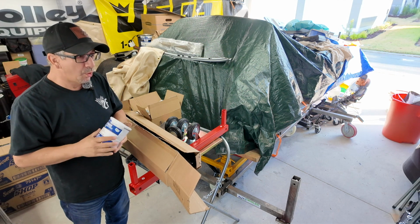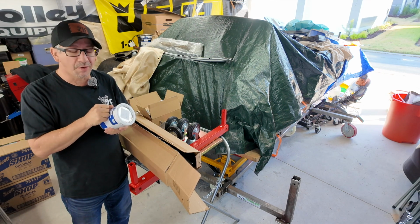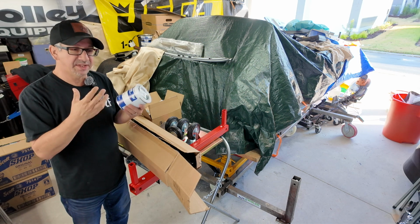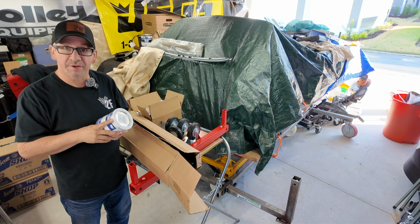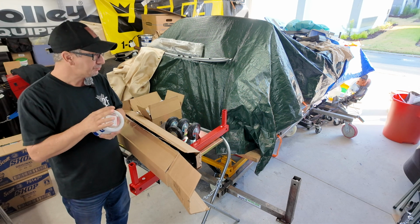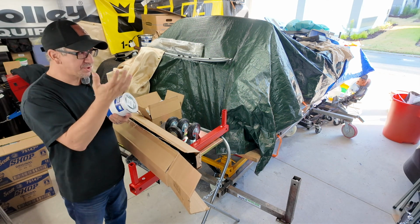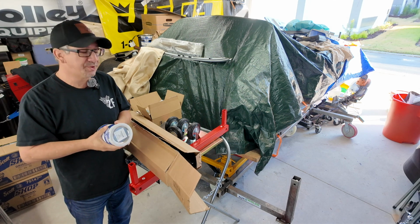So what we're going to do is approximate that color on the bottom of the car, because it was built in Dearborn. Dearborn cars got the slop gray paint. The San Jose cars, and starting a little bit later, the Metuchen cars in New Jersey, got red oxide primer. That's how you can kind of tell the difference between the assembly plants based on the underside color of the car. They would never be red if they were coming from Dearborn.